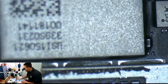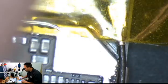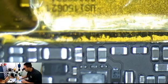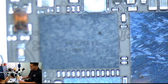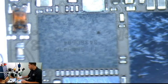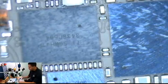Now you can skip any precautions if you're fast and smooth — you probably won't have any secondary defects. But I like to be safe. The WiFi connector here, just place some Kapton tape over that. Then we'll place some heatsinks — just standard issue nickels or quarters. We are set to go.